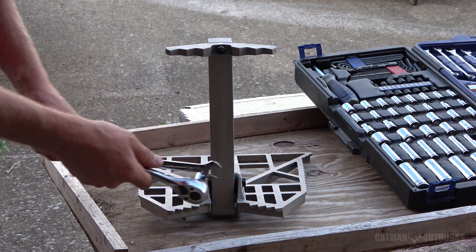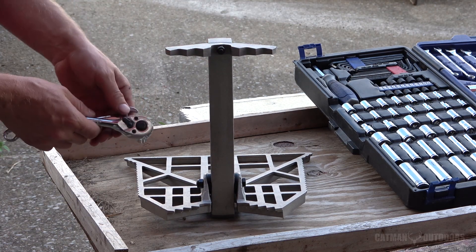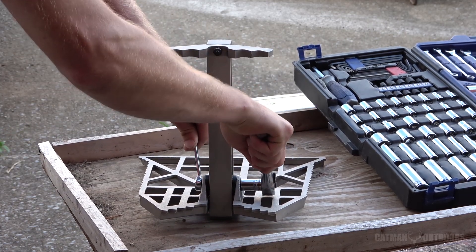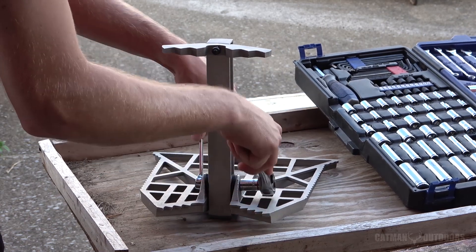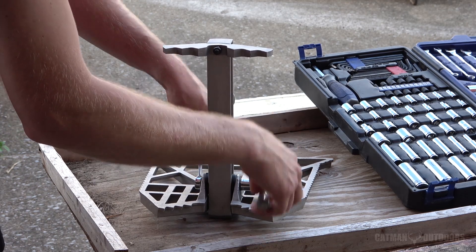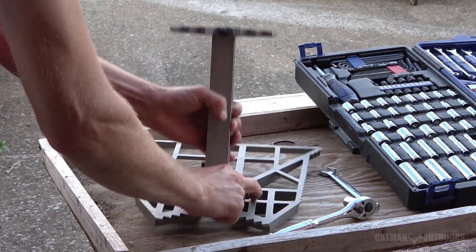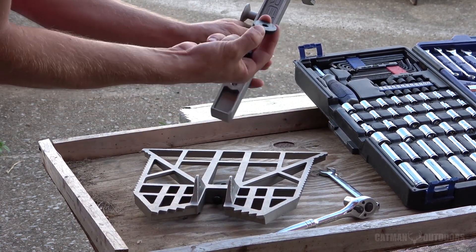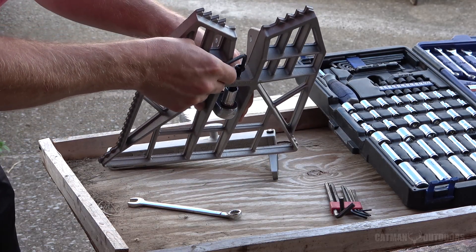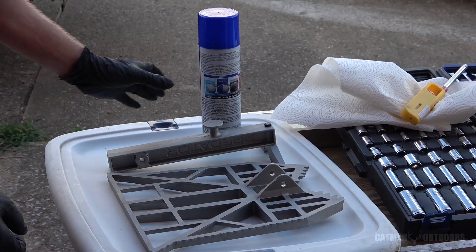All the lower bolts take a half-inch socket or wrench; the upper bolts are a little smaller, but I'm going to leave those on — they're nylon lock nuts so they don't back out on their own. Don't mind the chickens, something's got them fired up. Save these bushings.